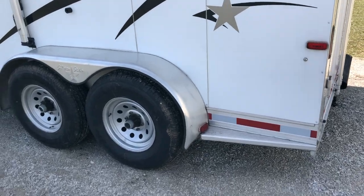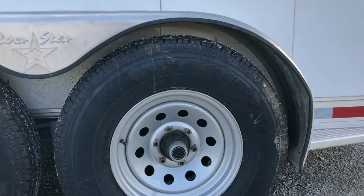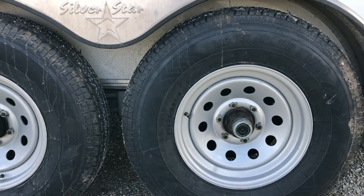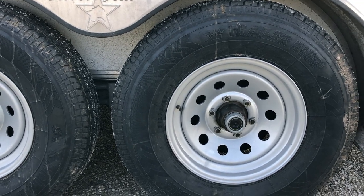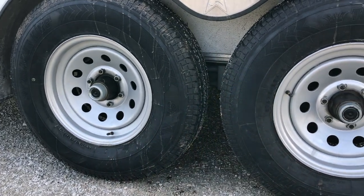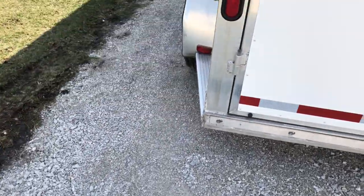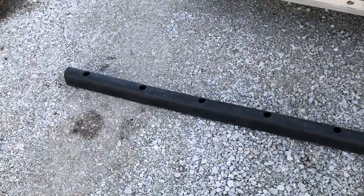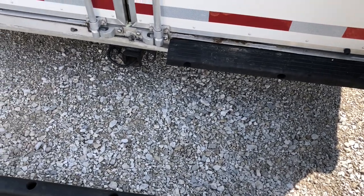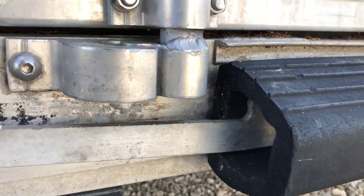Some other stuff I did about two weeks ago: we travel around a lot for horse shows and the trailer tires were getting a little old, so we went and got some tires. When I was doing that I was spinning one of the hubs and there was a little grinding noise coming from one. I pulled it apart and the brake shoes fell right out of the thing, so I went ahead and put new brakes all the way around and fully repacked all the bearings - they all looked in really good shape. This bumper is 96 inches long and the trailer is not, so you can only order them at that length and just have to cut them down. The bolt holes are a little bit narrower, so we're gonna have to redrill holes, get some more bolts, and do it that way. They have an aluminum piece that works as a little bit of support, so we got to go ahead and pull that off.